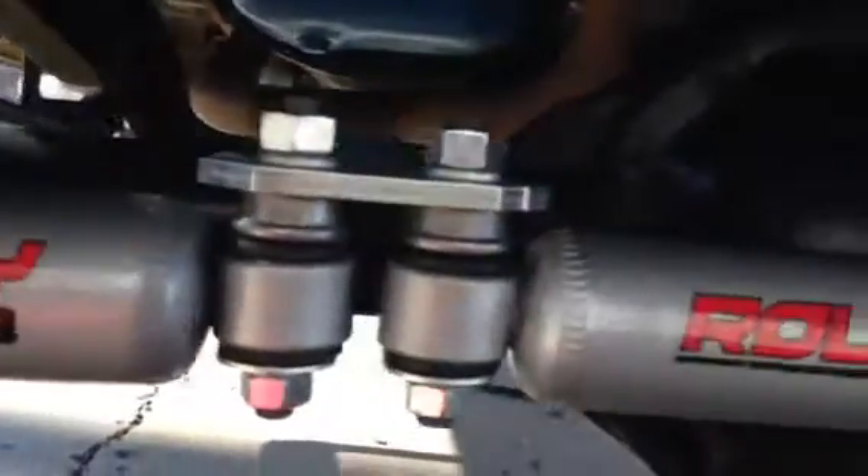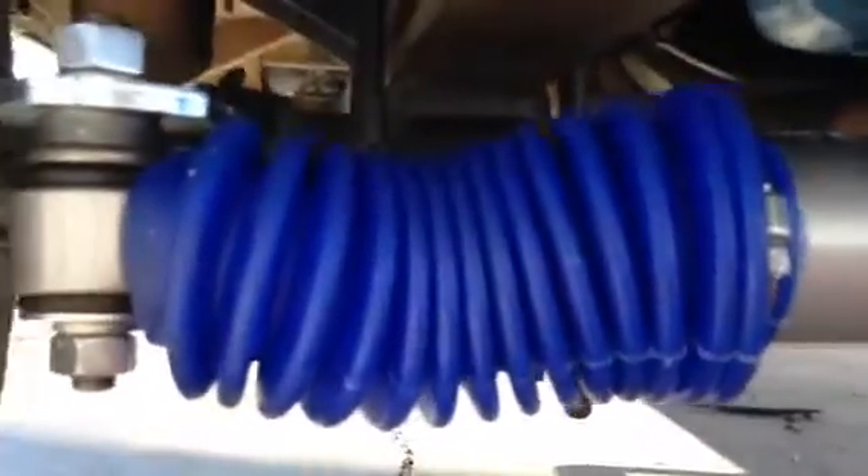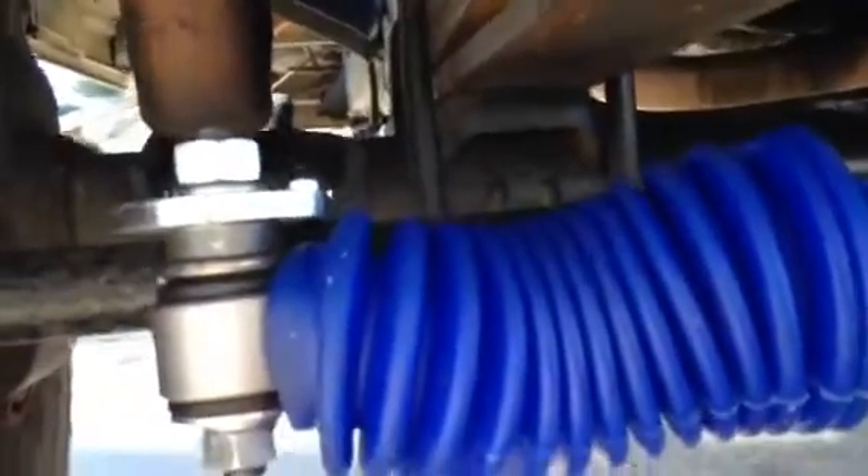You center up your center bracket and put that on there. Put your pins in here and here. The kit recommended that you measure out four and a half inches — right in there is the end of it. Four and a half inches. Then you just put those U-bolts right around there, and you do that on both sides. Tighten it all up and make sure that it doesn't interfere with any of your steering. And that's pretty much the install.